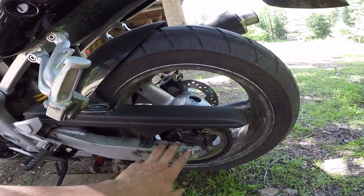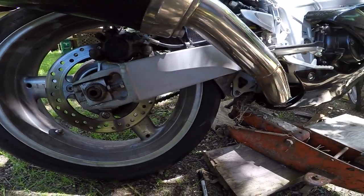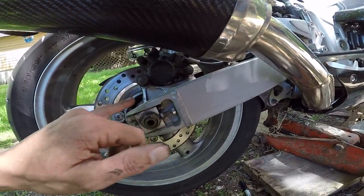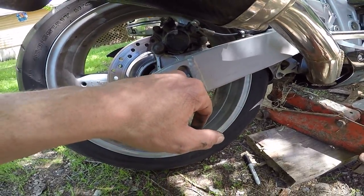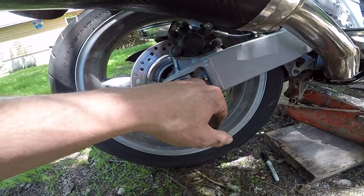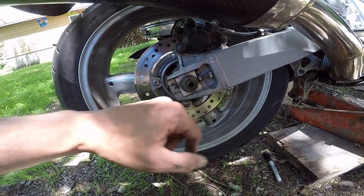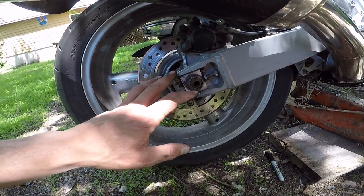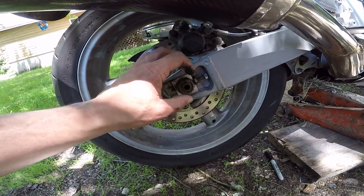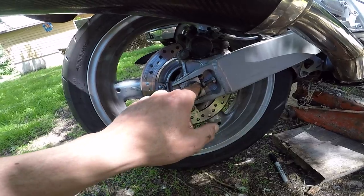I'll take my measurements before I lock down the axle nut. What I did with the tire on the ground — nothing was moving — I cracked that nut first, the lock nut. According to the manual on this bike, it's basically 27 Newton meters, which registers to normal people as about half to three-quarters of an inch past the tight spot. When the nut touches, just turn it about three-quarters of a turn. When you do your test run, don't go very far — do like a kilometer, come back, check everything is tight, and monitor it for the week.